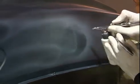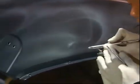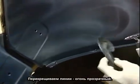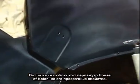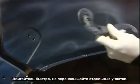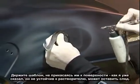It's okay to layer your paint at this point because an airbrush doesn't put out that much material. Always remember, your paint can puddle. You don't want your pearls to puddle up. And overlap lines, because fire is transparent. That's why I like to use the House of Color Snow White Pearl. It gives a transparent quality. Keep it moving quick, don't want to pull it up. Keep everything moving quick. Keep the stencil off the surface of the car, because you don't want it sticking to it, because like I said, once again, these are not solvent proof.